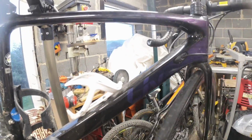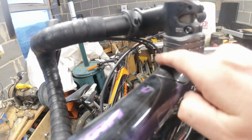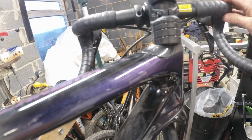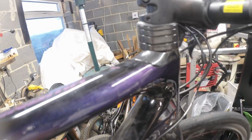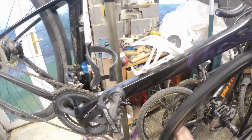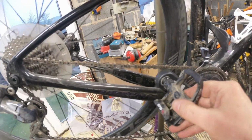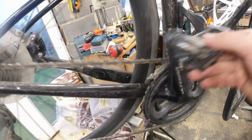And we've got a rush job that needs to be done for the weekend because they're going away. There's something going on with the head tube. It's wearing in there, which it shouldn't be. It's also very loose as well, so I'm going to see if I can nip that down. Wheels seem okay. There's no bearing play there. Everything's moving there. But the bottom bracket is very, very draggy. So I'm just going to give everything a quick squirt down with some degreaser.